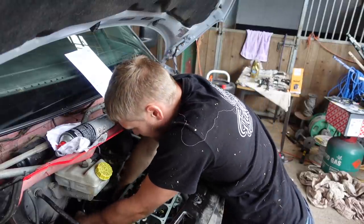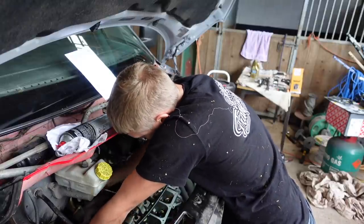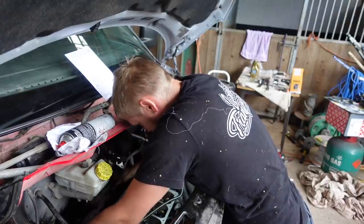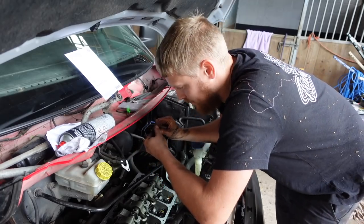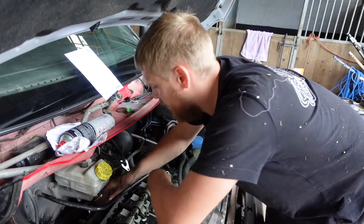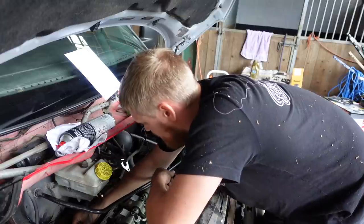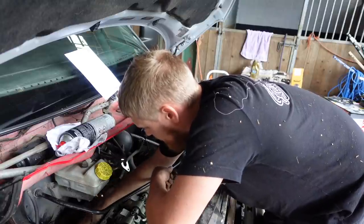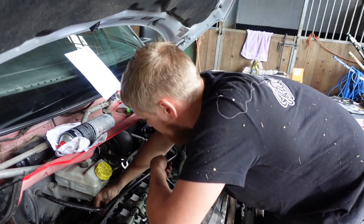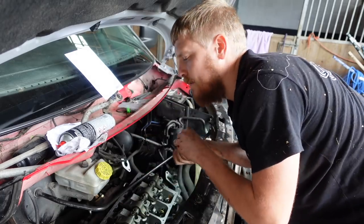Put it in the wrong place, which is great because the head's already on, so I can't move it. And for the exhaust manifold bolts, you've got a washer that goes on first, and then the nut. So it's washer on first, and then the nut. Do this all finger tight for now. Now, don't drop that in the engine. My aim is to try and get everything back to the point where I was doing the cam belt, and then I can put the cam belt back on.